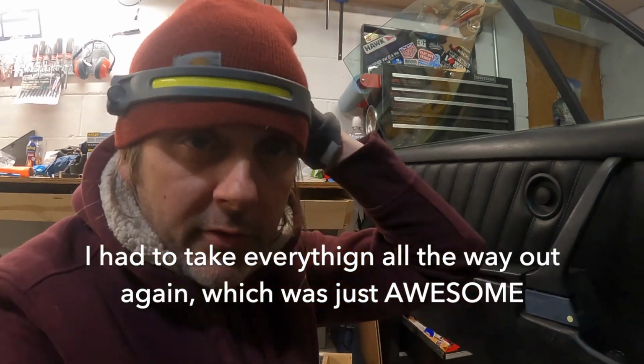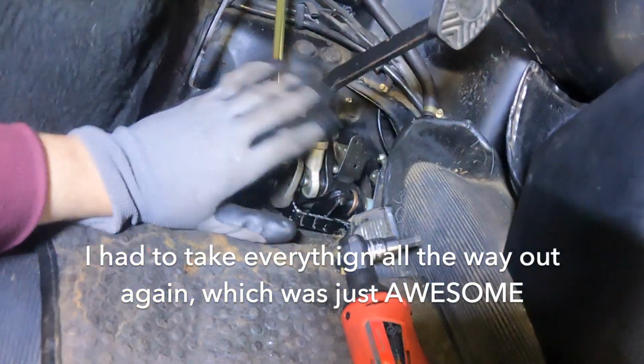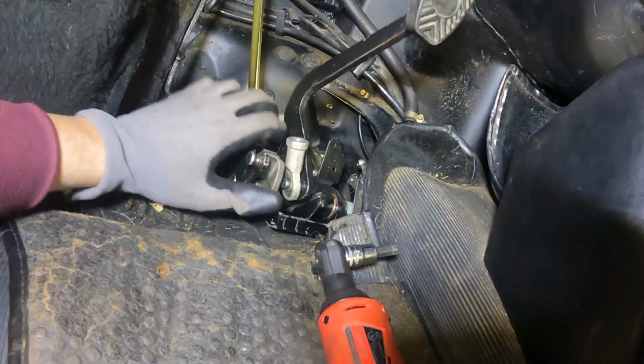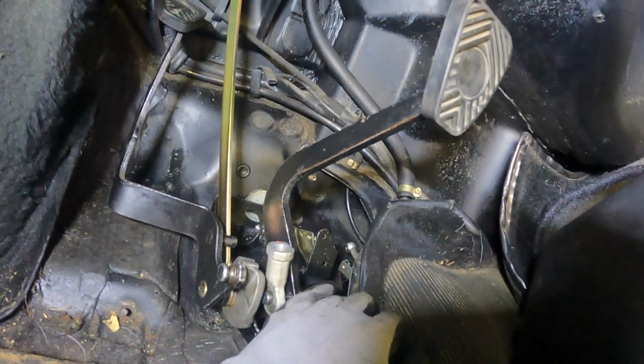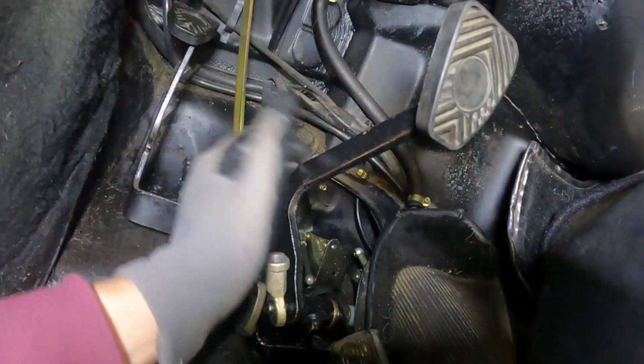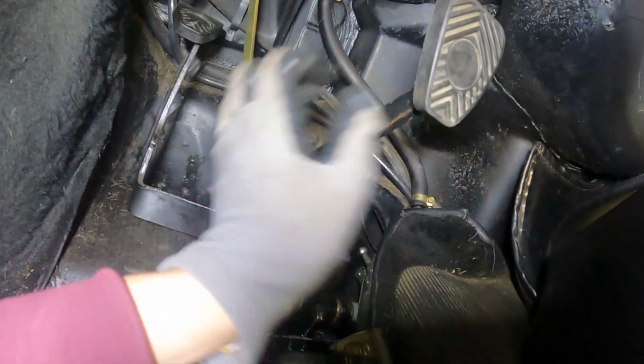Not gonna lie, dudes, it's been a few days. Unbolt everything, remove the f***ing spring, and twist it at an angle, and that's how you're gonna be able to get that clutch arm hooked up. That's the only way I think you can do it, because of the metal here, so there's no way to reach in there and put on the clutch arm.